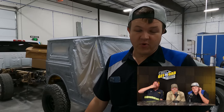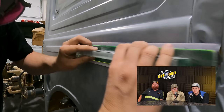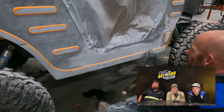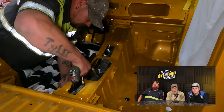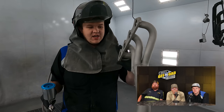I just guide coated everything — got about four days' worth of sanding. I'm going to 320 block all my flat spots. Taking off all of our edges so we can keep our body lines, going through and blocking it out, getting it straight. Steering wheel installed, gas pedal installed, brake pedal installed. We've got the Golden Nugget exhaust header and we are going to spray Cerakote. We put a ceramic coating on your exhaust — it's good up to 1800 degrees.